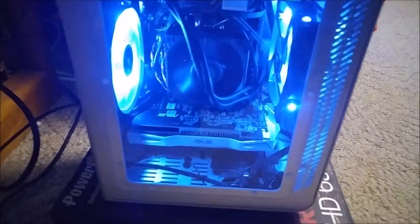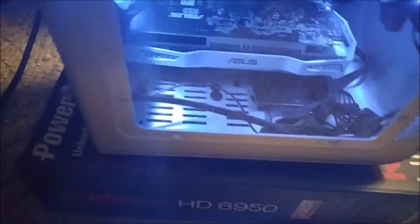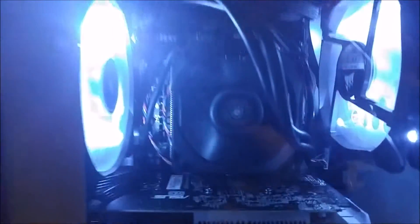I've gone a bit over budget with this build — it was supposed to be more of a budget-friendly ITX build. It still is, just not so much for me. Most of the mistakes were on my side; I just didn't do enough research or plan ahead. As you can see, there's my SSD — I even barely got that to fit because the cords on the power supply wouldn't line up, so I had to screw in only the back two screws and leave the front two off just to angle it enough to plug everything in.